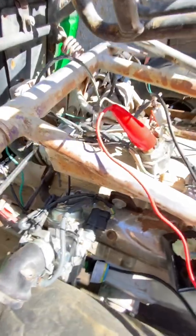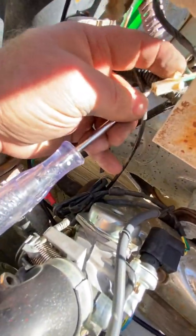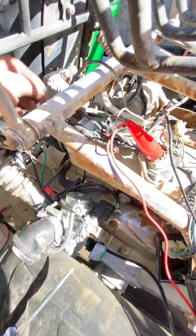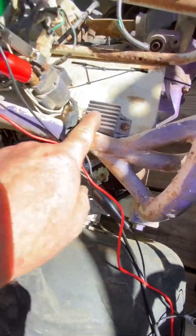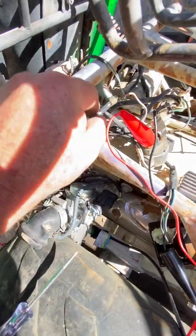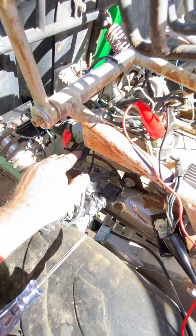Let me find my thing here — we should have power here somewhere. If I don't, I'm probably going to have to go find power for this, which this doesn't seem to have. So the only thing I'm going to have to do is track down and find a power source for the choke, because that's definitely not going to work there. This one has a little rectifier here; I'll go ahead and just replace it with a new one today. The harness is still complete so I'm not worried about that, but I am going to have to track down the hot wire for the choke, because these won't run right without that choke hooked up with power.